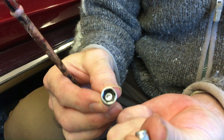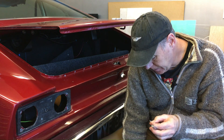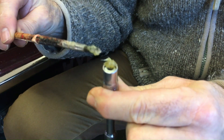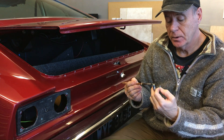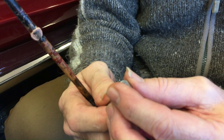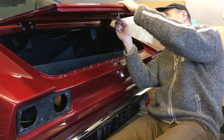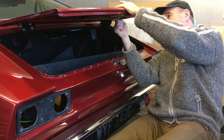Pop the nut inside the socket. Then, so as not to lose the washer, get your trusty pot of grease, get a good dob of grease on the end of a paintbrush and paint grease — a big dob — onto the nut and socket. Loads of grease — this will temporarily stick the washer onto the nut. With that in place, you're ready to just put the socket into the hole — and there we go, up she goes. I'm located — voilà.